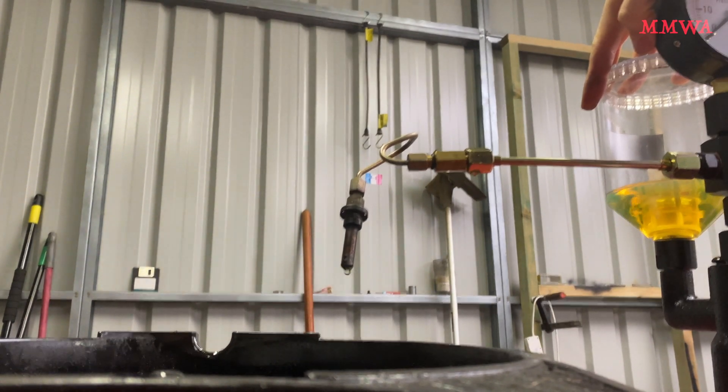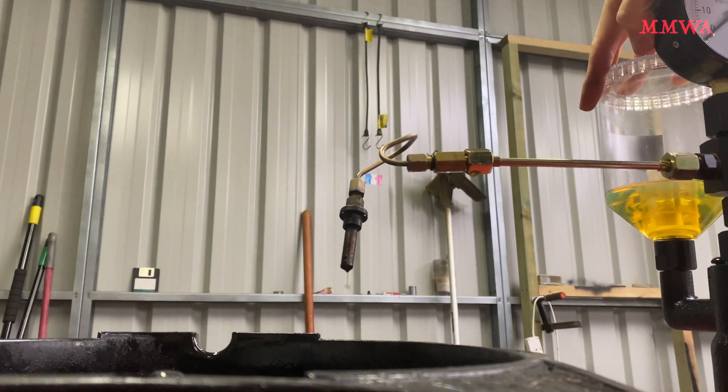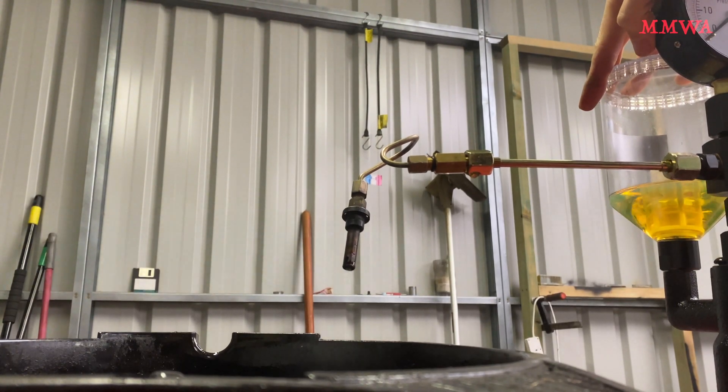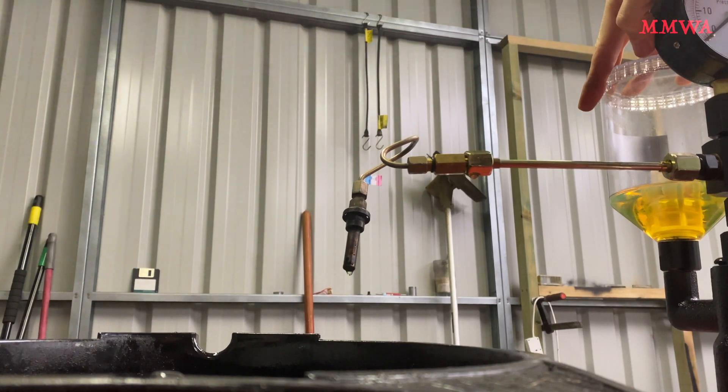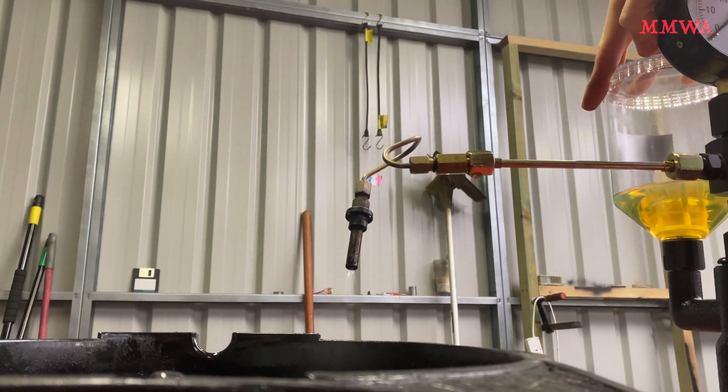Here's just a demonstration of it working. However, you should operate it nice and slowly — you don't want to get too carried away. This thing is capable of ridiculous pressures and you will destroy the injectors if you get carried away. I'll show you that shortly.